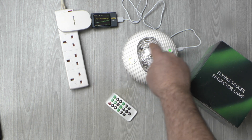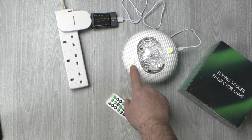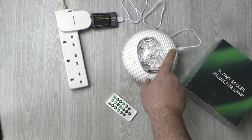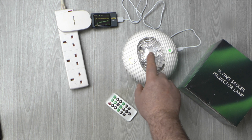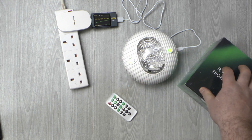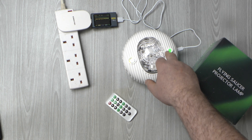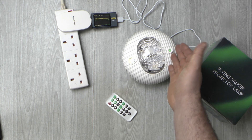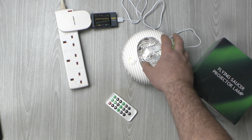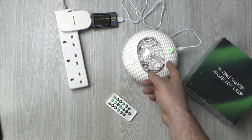So you can see the motorized lens in there. There's also a lens here which is just projecting an image of the moon onto the ceiling. And there's a laser here which projects a fading in and out star field. The one thing I don't like about this unit is that there are no warning labels on it to say what the power output is, what power class it is, or even a warning to say it has a laser on it. That's the sort of thing that could get this recalled from sale.